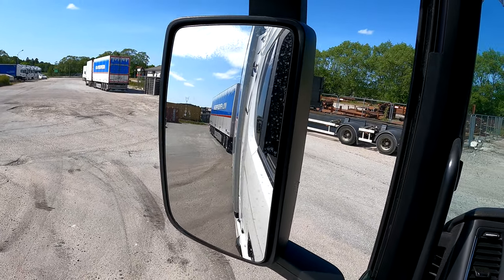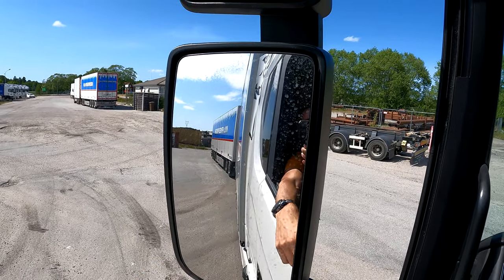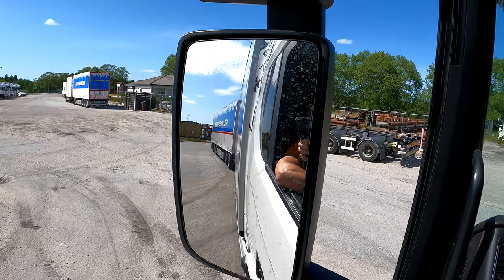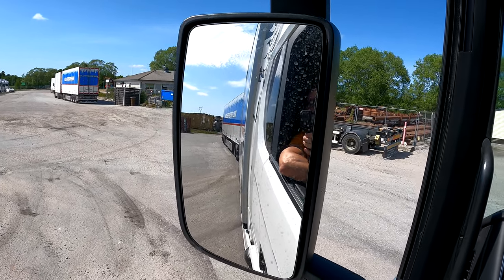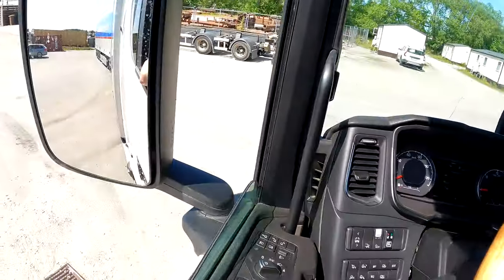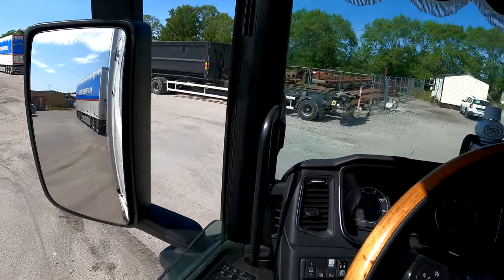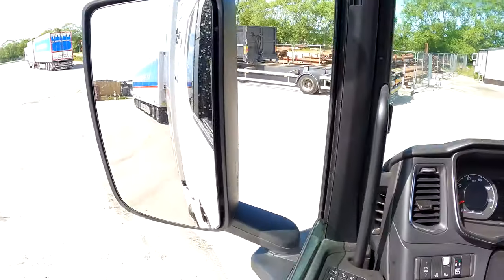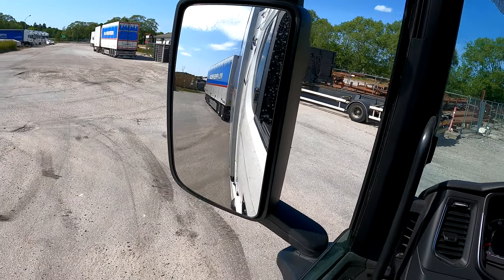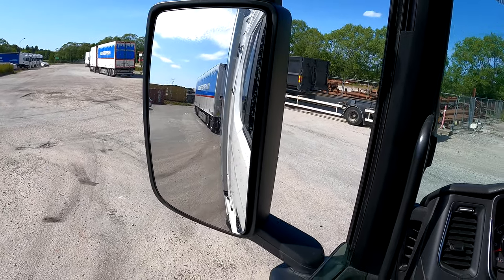And now if I continue this angle, you see that I'm decreasing the gap between the corners of the truck, the front corner of the truck and the trailer. If I decrease more, it's gonna turn more again, you see? And now the front axle is turned. I don't want that. So I'm gonna hit drive, keep the wheel as it is, drive forward, straighten it out. So you wanna match this, reversing, by turning the truck so that you always look at the front axle of the trailer.